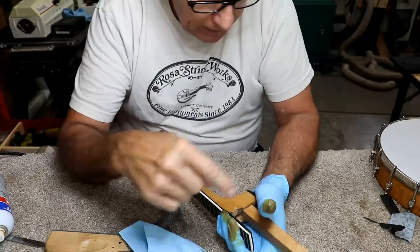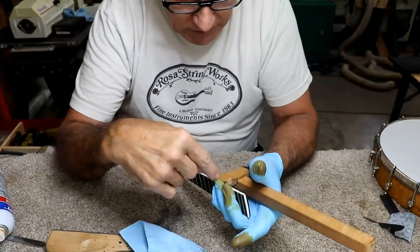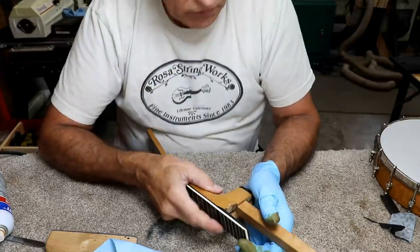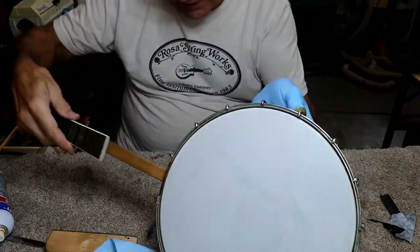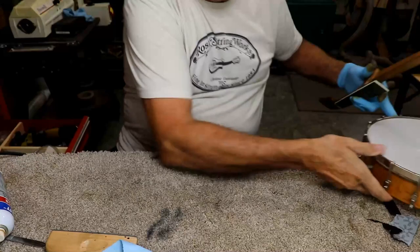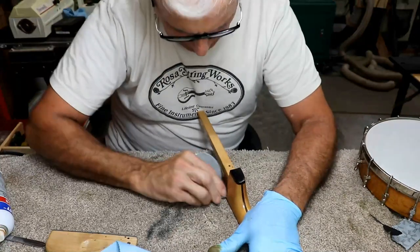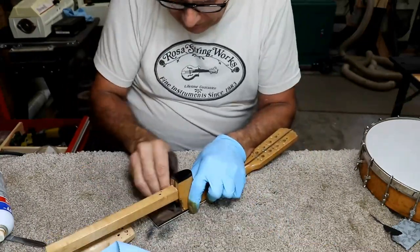When I put this back together I'm going to make sure this isn't getting forced up in the air. I think that's where my biggest ducktail is coming from — it wasn't tight here and it was getting forced up in the air. I'm probably going to have to cut some more of that hole out. Now I'm going to check this and see if it'll go in without bumping that — and I think it is bumping it. It's rubbing pretty good underneath here. One option is to see if I can cut some of it away.